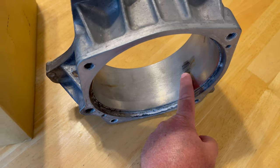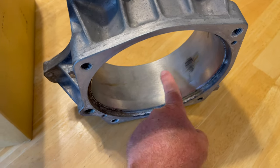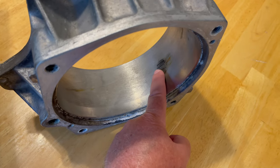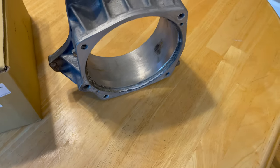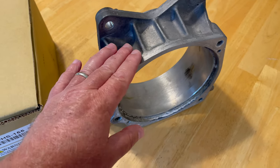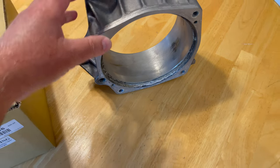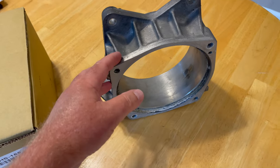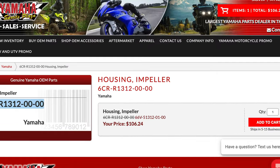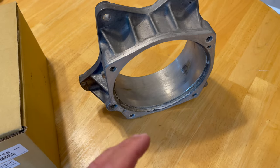That is all you need. The tolerances of the impeller spinning in here are so tight that any little swelling of this ring, you're going to start to get rubbing. You're going to get a familiar kind of banging sound as it's running in the driveway on the hose. So I had to replace this. My mistake two years ago — I'm a big OEM guy. I bought for about $106 the replacement Yamaha OEM impeller housing. It's only two years gone and I'm starting to get that same sound again. It's starting to bang again.